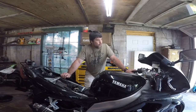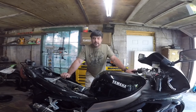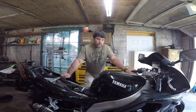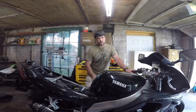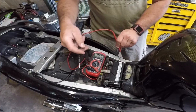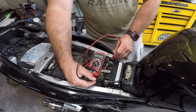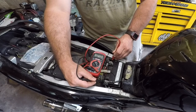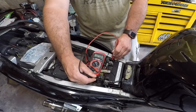I actually did figure out what is going on and why my motorcycle shut off. In today's video we're going to go over the charging system and see what the issue was and why the bike stopped running. What I like to do is, with the key off, I check the voltage. As long as you've got over 12.5 volts you should be good. This one's sitting at about 12.7.